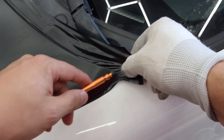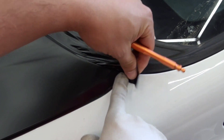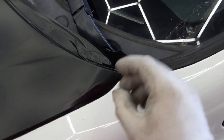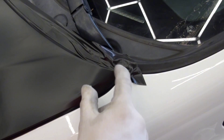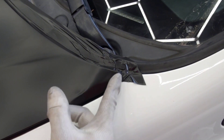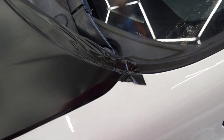Here guys I'm using a little dimple tool to make a pocket for that corner. Once you shrink it, that little dimple will anchor it down to that corner so you won't have any stretch back, and it will actually hug around that corner for you. I'll link this tool down in the description — you can get it from several places such as Amazon, Yellow Tools, and other places. On Yellow Tools it's a little expensive, but on Amazon you can get dimple tools which are similar — not exactly the same, but they work exactly the same way.